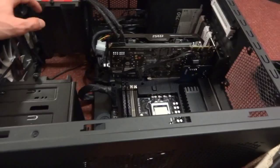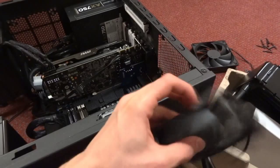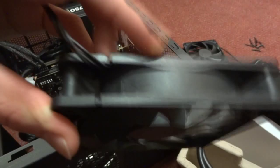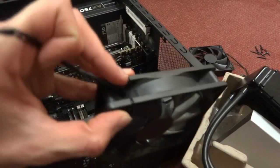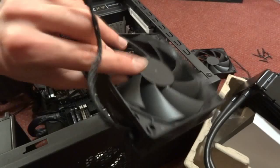Now I'll install the radiator. Pop in the screws to mount it to the case. One thing I didn't mention is the reservoir — the Antec 920 has a reservoir, and it's recommended to have it facing toward the bottom of the case. This prevents air bubbles from forming in the loop, which can decrease cooling performance. If you hear literal bubbling noises, you'll know it's because of the reservoir orientation.